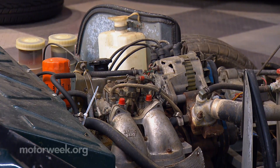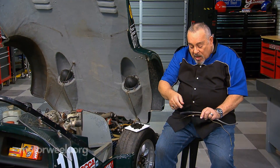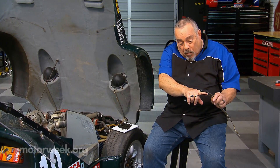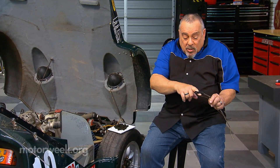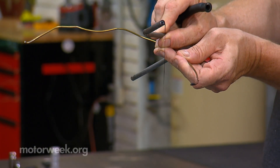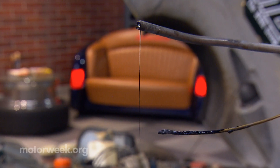So far what we've done is we've looked at the fuel lines and things like that. We ran this coat hanger down into one of the fuel lines and it came out with this thick sludge. That's what happens to fuel after it sits. We can actually see it in this fuel line — you can see it just kind of strings out of there. No gasoline left.